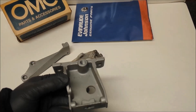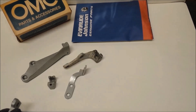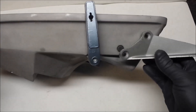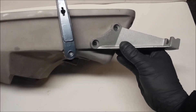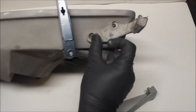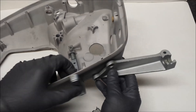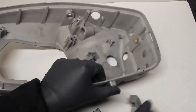There are a few different ways to connect your throttle and shift cables. This is a mock-up for my demonstration — this is an older style attachment for your shift cable. See how long that is? That's one reason I think they moved to the more modern, smaller bracket, which attaches right there with a cable running through to your shifter. If you're limited on room, that may be an issue, especially when you consider you're also going to have a steering bracket out front. I'll show you one of the problems with using this part versus the newer one.